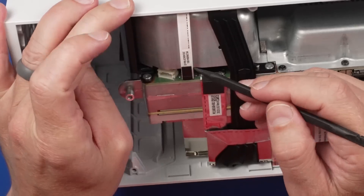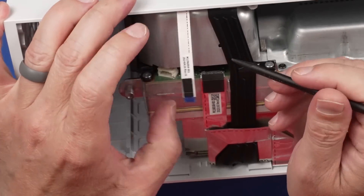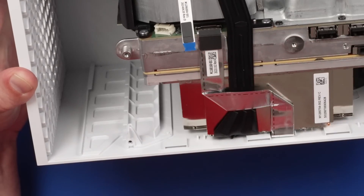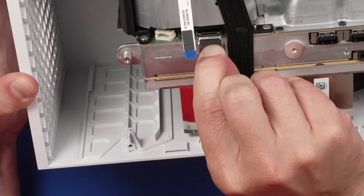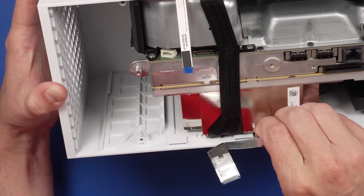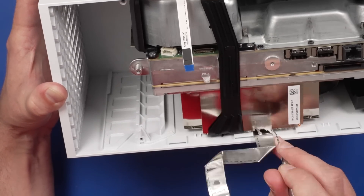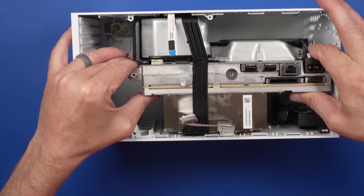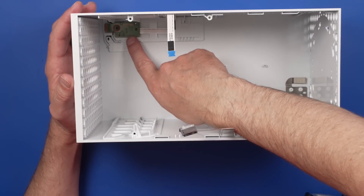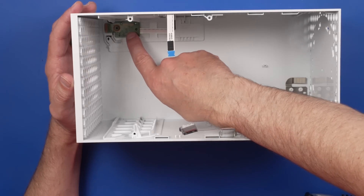We'll get a better look at that in a minute. To remove this cable, we need to depress the locking tab on the back, and then wiggle it and it just pulls right off. For this bigger cable, we need to pry up on the locking bracket on the top, then grab the pull tab and pull it back. We also need to remove the cable from the adhesive there, and there's some adhesive down here as well — I'm just going to cut through that. With those cables removed, we can push the sandwich back and pull it straight out. One thing I noticed right away is this board is much smaller on this model than on the previous model, probably because we don't need an eject button — just the power button.